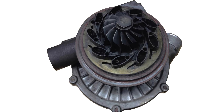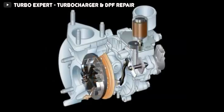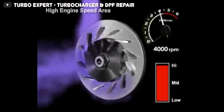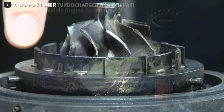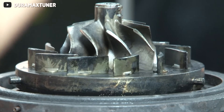On the side of the cylinder head is a Honeywell variable geometry turbocharger, which is pretty much standard for any modern diesel truck. VGTs work by using movable vanes to effectively change the size of the turbocharger, impacting how quickly it spools and how much boost pressure it produces at certain RPMs — giving you the benefit of both a small and a large turbocharger in one system. One big benefit is that it allows for exhaust braking, although reports online highlight that the exhaust brake on this engine is pretty weak compared to larger diesel engines like the 6.6.